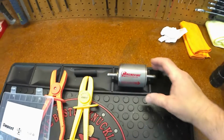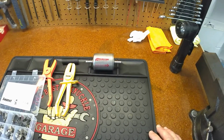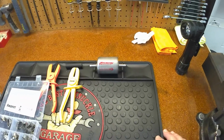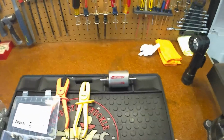Now, on the Toyota FJ Cruiser, the actual transmission pan, if you pull it, there's something up there that looks like an old-fashioned filter, but it's not. When you take it apart, it's basically a screen for big chunky bits. It doesn't really have any type of filtering properties. Again, it's just a screen, and that really kind of bugs me.